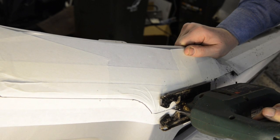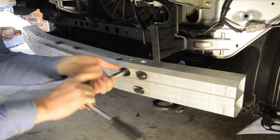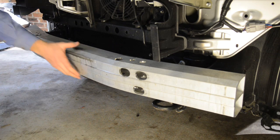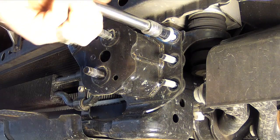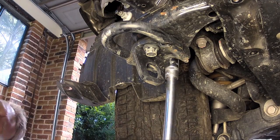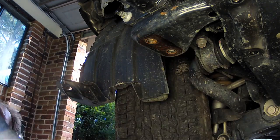Be sure to keep your fingers clear and wear safety glasses to protect your eyes from flying debris. Moving back to the vehicle, you can now remove the foam absorber bar and the aluminium crash bar — these won't be reused. Then remove the beam mount brackets and retain the nuts for reuse. Next, remove the tow hooks and set them aside. Both the hooks and their bolts will be reused later.